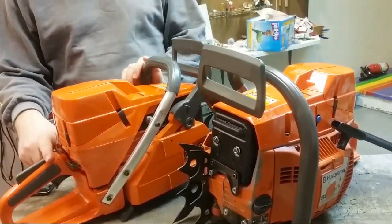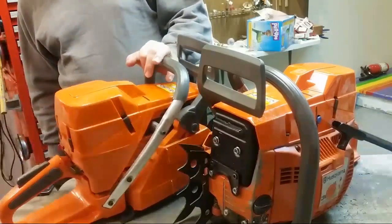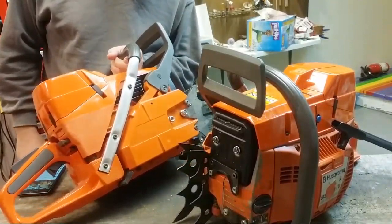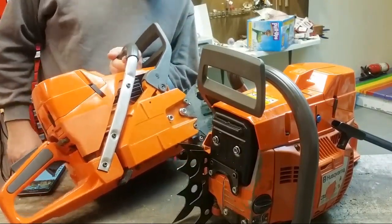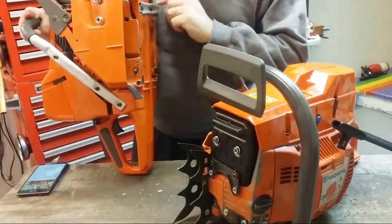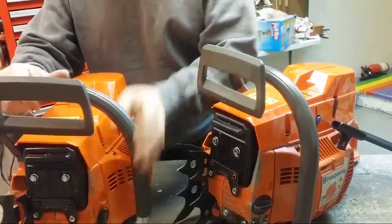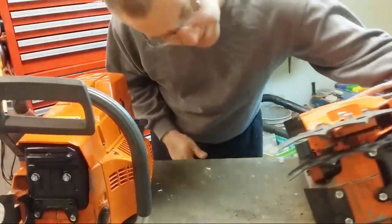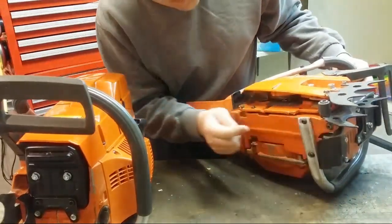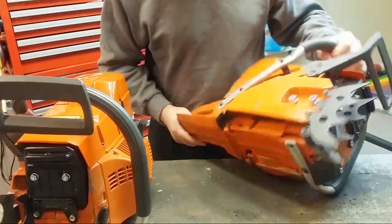Yeah, this one has a brand new gas tank. That's $150 just for that. I had some welding done on the cases to make sure they were solid. The welding was done by Sean Carr, and he's known to be a really good welder. Magnesium welding is hard, and he does a nice job. This AV mount down here had to be welded back on. He actually re-welded the case, and it's nice and solid. It's good.